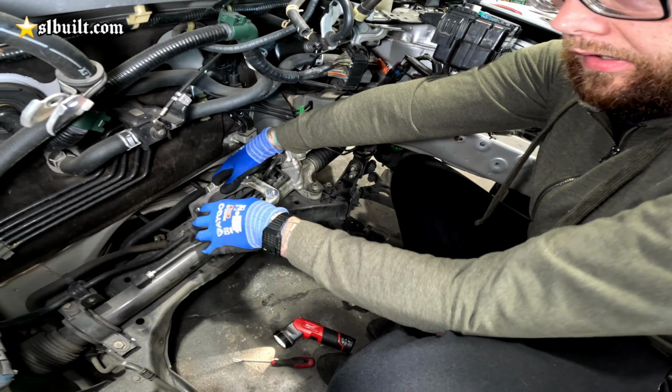I don't think it's gonna work. Oh, we're definitely going to have to move that steering rack, I think. I don't think so. What about the whole subframe? You know what? We're gonna have to cut the subframe in half and then weld it back together. Yeah, we have to. Literally, just like the Toyota over there. We might have to do something about the back mount. We're gonna have to remake the whole back mount somehow, because if you cut it, it's gonna mess up all the back mount. Oh, yeah, of course.